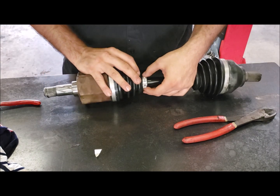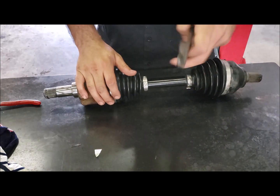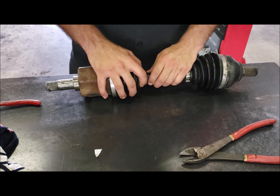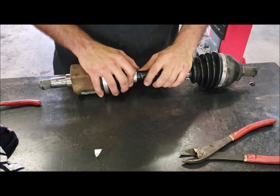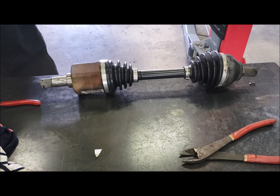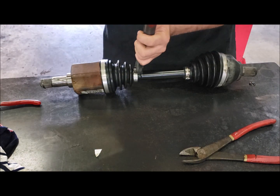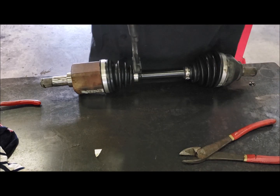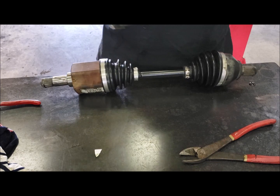Now that's all that's left to do. The inner band is already pre-positioned - we just need to squish that one too. Using your blunt side cutters, squish it together real hard - make sure you are in the ridge. You can see the little ridge - squish it right there. Then use the nail pincers with the extra-long arms to get either side and finish the clamp. That's your CV joint all done.